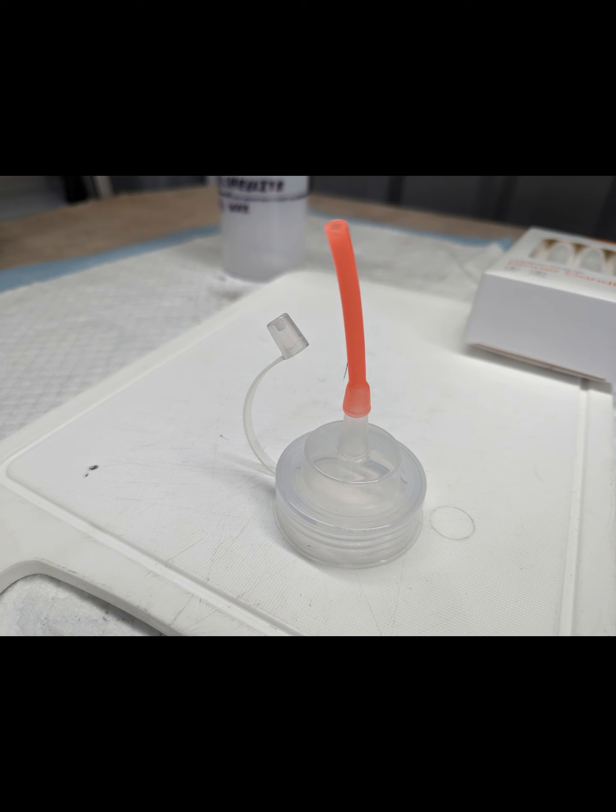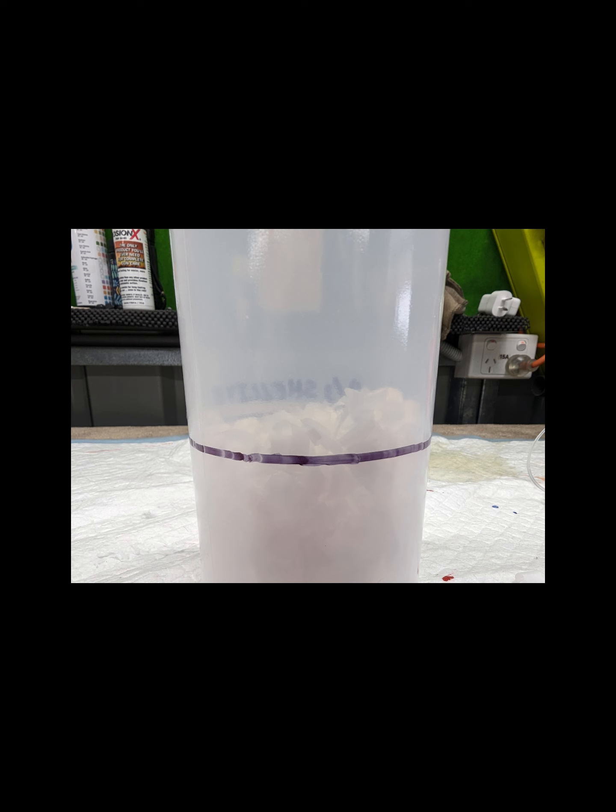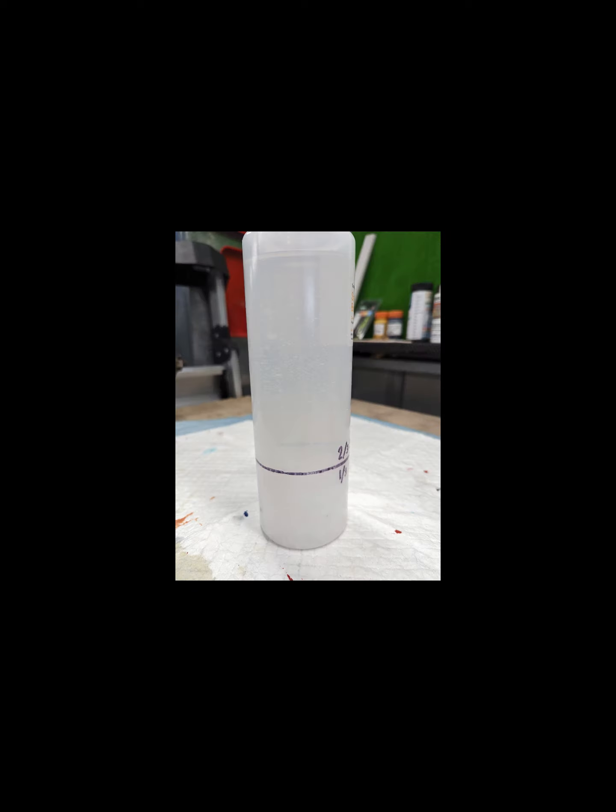I then modified the bottle lid a little bit, because the nozzle that's there is for tomato sauce — obviously it's too big, too much lube will come out. So I just put a little dripper tube on there. He was saying one third of the bottle to be paraffin wax, and then two thirds shellite to fill it up — so that's what I did. I put a bit more in, then you shake it and it compacts — I ended up a little bit over, but that should be fine. Then I filled it up with the shellite. It all kind of settles to the bottom, so you've got to keep mixing it — every couple of hours turn it over and give it a mix — and it should take overnight to fully dissolve into the mixture.